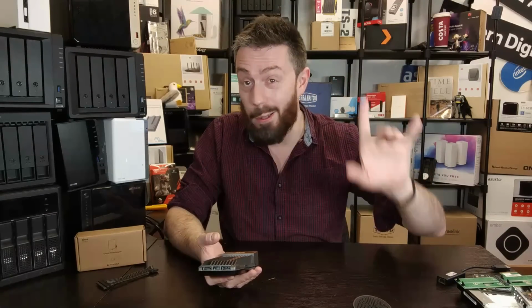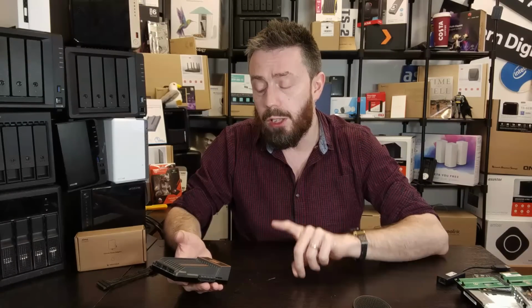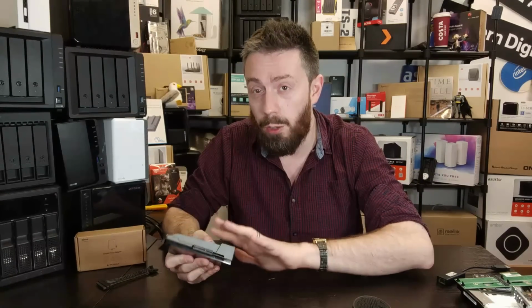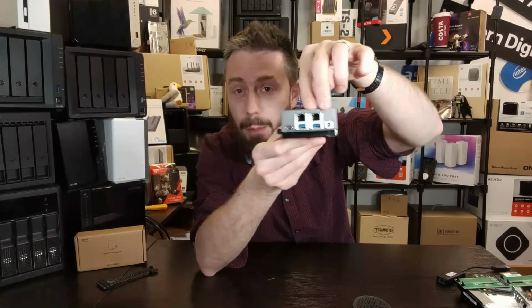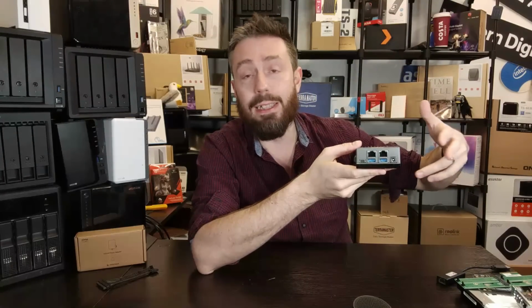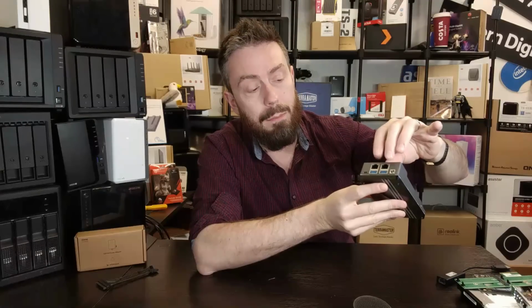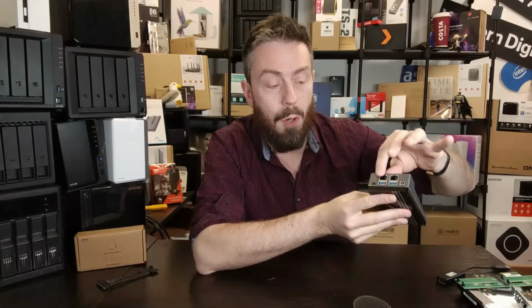Now, the ports and connections on this thing are out of this world. But we have to at least keep our feet on the ground and acknowledge that because of the CPU architecture inside, it's still x86, but definitely an older generation CPU that's being used. The result is that although the ports and connections are numerous, it's worth highlighting that they are not exactly bleeding edge 2023. Example, if we look at those ports there on the back, we've got a couple of Ethernet ports there, and again, depending on the software you use and the configuration, not just the CasaOS it arrives with, if you want to go for a third party, bear in mind they are both 1 GbE. Again, you can assign WAN and LAN to your own configuration, but just bear in mind you're running on 1 gig.